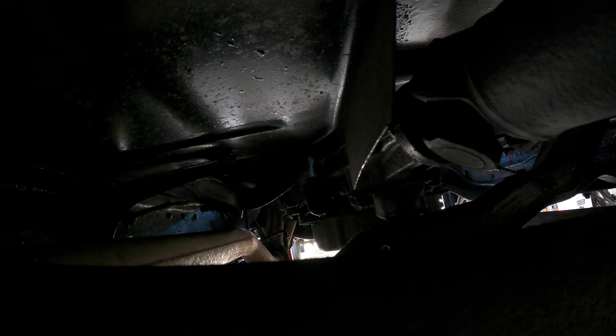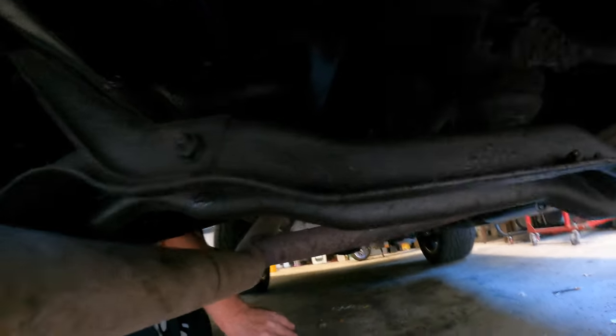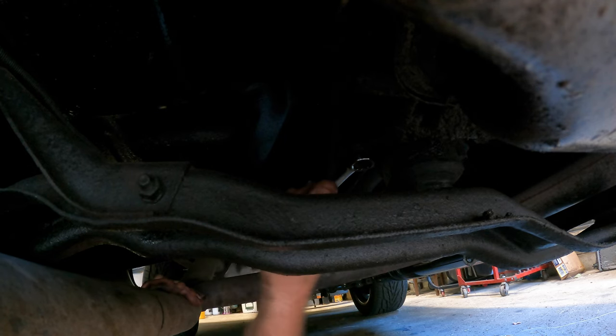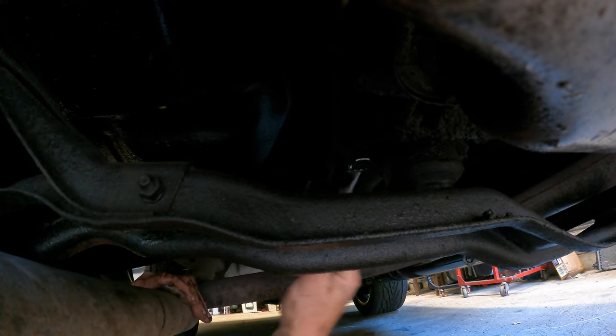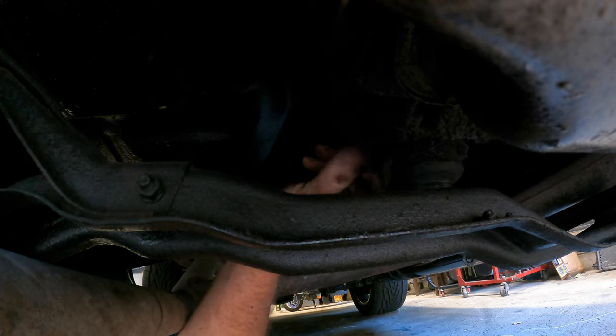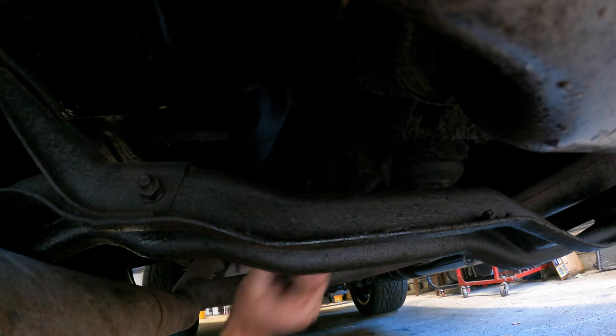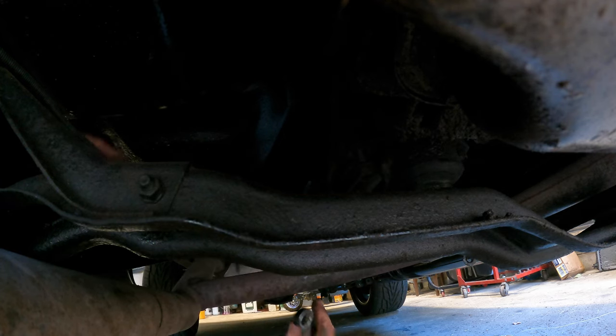What did I come up here for? I always come up and forget what I'm coming up for. We need metric — where's all my metric Snap-on wrenches? Must be under the hood — nope. Oh, here they are, they're over here. We gotta get a 14 and a 15 and hope for the best. So we're up here now and we're gonna take these bolts out. That come off easy — there's one. As you know, this is a transmission mount. There's one that goes through the crossmember and two that go to the transmission — once you get them off she's pretty much done.